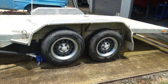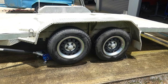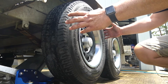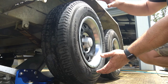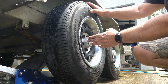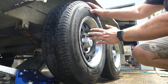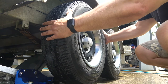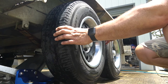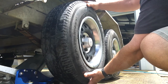This is just a basic check to make sure the bearings are safe to use. I found that this bearing here needs some work — I've already got the wheel jacked off the ground. Now to check your wheel bearing, you just grab your wheel and you rock it back and forth this way and that way. If you feel any sort of rocking motion, generally your bearings will need some work.